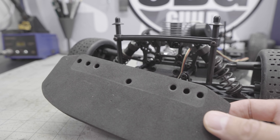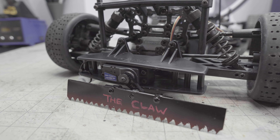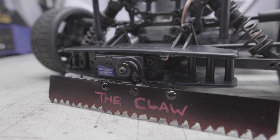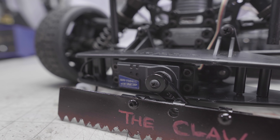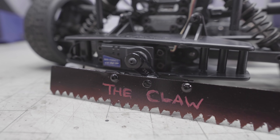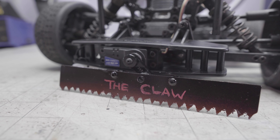That way it doesn't look like the car is being held back by anything — it's sort of an invisible solution. I'm actually feeling pretty smart about this, though I'm hoping the car doesn't have enough torque to rip that servo out of its position. What I did was take the existing bumper mount from the front of the car, moved it to the back, screwed my servo in with a couple of existing servo mounts, and cut up a piece of 16-gauge steel I had lying around. I could have used a saw blade, but what better way to reduce, reuse, and recycle using materials you've already got. I feel like this is a pretty interesting solution and the sort of thing that can work.